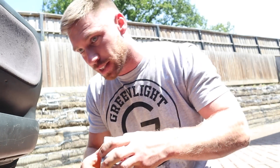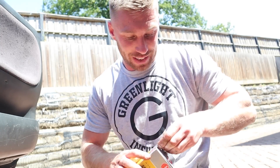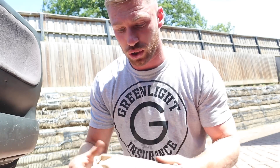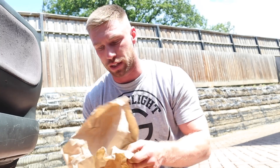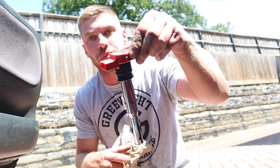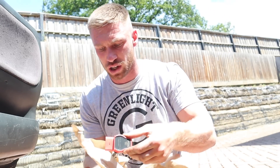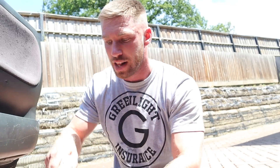The reason you get these — as you know this car is from 1989 and these coil packs are also from around 1989, so as you can imagine they're crap and don't provide a decent spark. When I was arcing the coil pack you could hardly even see a spark — it should be a lot stronger. So what people do when going big power in these engines is fit the R8 coil packs. These are NGK ones — you can get the NGK ones or the Audi ones, pretty much the same. I've checked with the CA boys and these are the right part numbers.